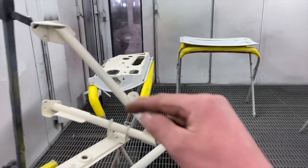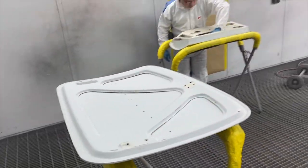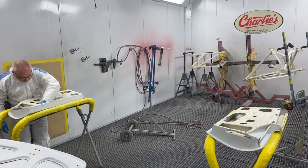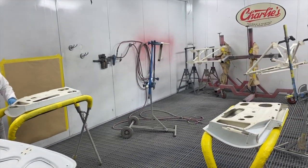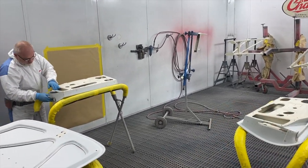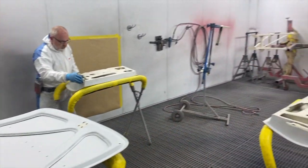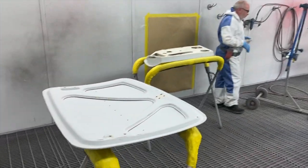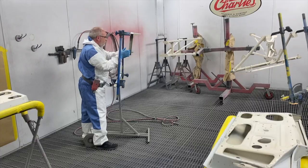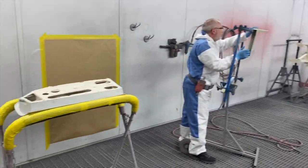He's done the seam sealing around like the edge of the door skins and everything and the joints, but probably this time, when we painted the shell, we weren't 100% happy with how the colour covered in the corners. It would cover all the flats, right, but just in some of the corners it was still a bit transparent. So we are going to base all of this up in straight black first, probably 2 coats of black, and then we'll put the blue on, and we will most probably do the outside of the car when we paint that in the same way.